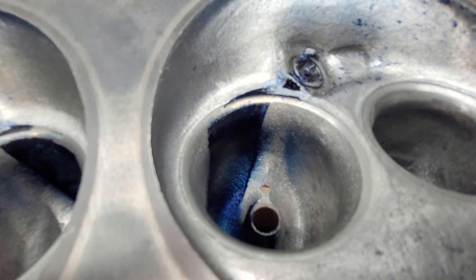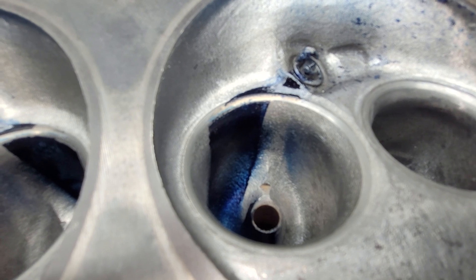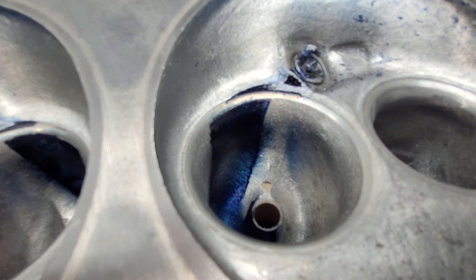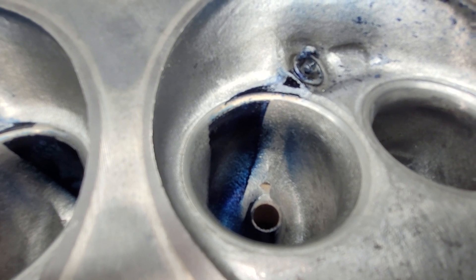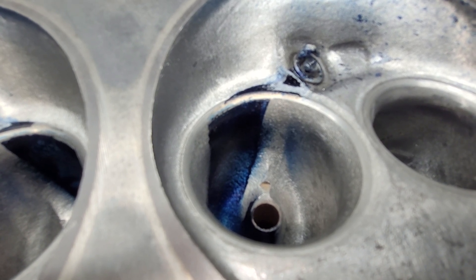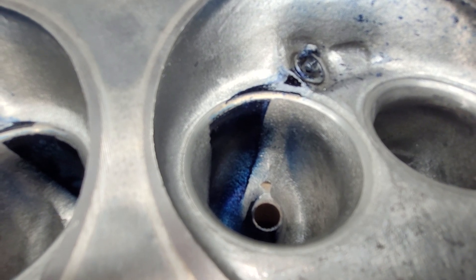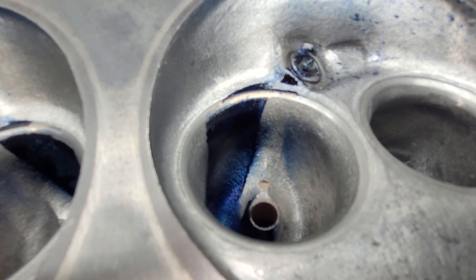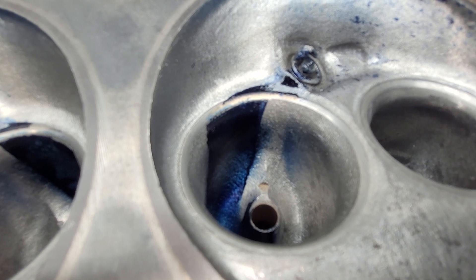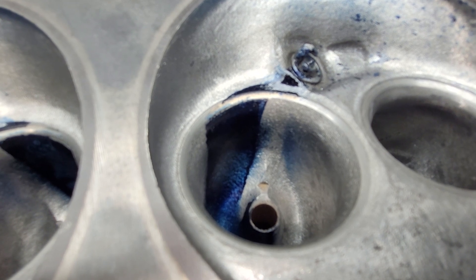It's kind of like guys putting an intake port on a Chevy that flows nearly 300 CFM and then coupling it with a Performer RPM — the Performer RPM only flows about 220 stock. It runs great but it doesn't run anything near what it should run. Interesting point, right guys? Alright, I think it's time to eat. Thanks for hanging out guys, have a good night.